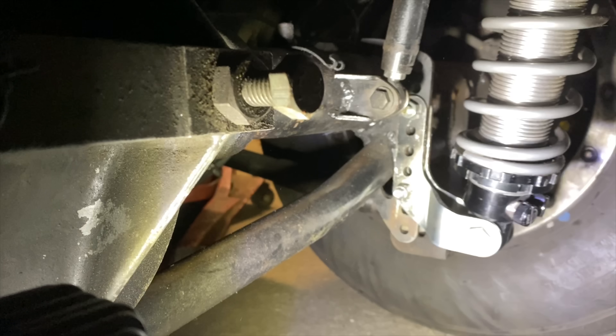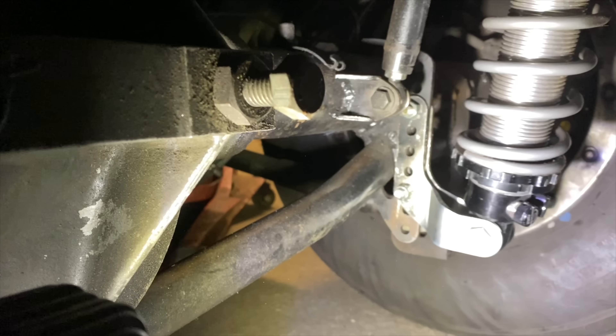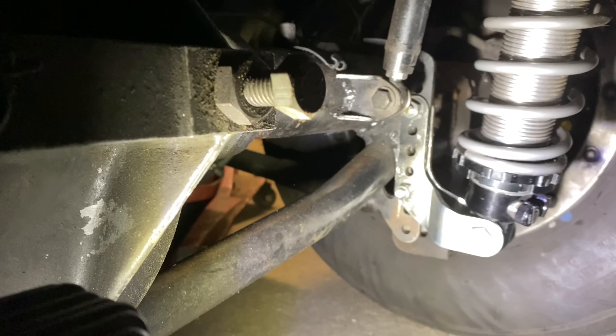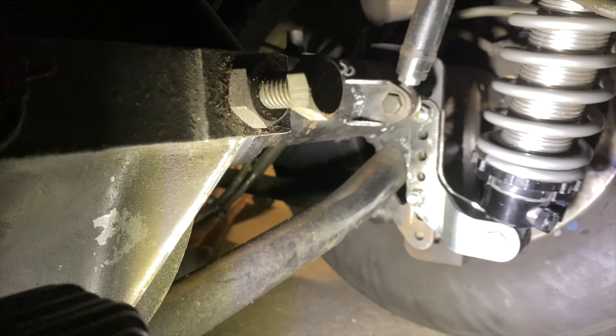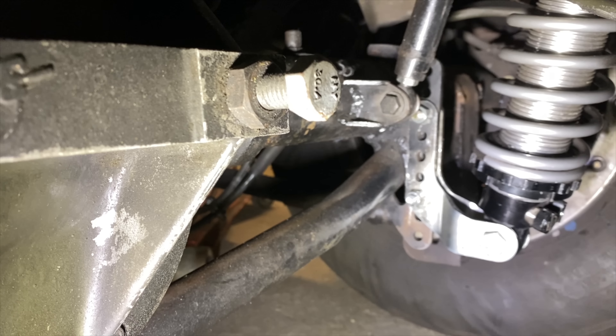So I had to run that coilover down just a little bit because it was too high on that side. Can you let down the jack? So now we're fixing to throw it on the scales here in a minute. We'll make sure it's even. Go ahead and let it down all the way. Push down on the back. See if that's pretty even side to side. I can get a finger on this side and a finger and a half on the other. So the right side is still just a little high?